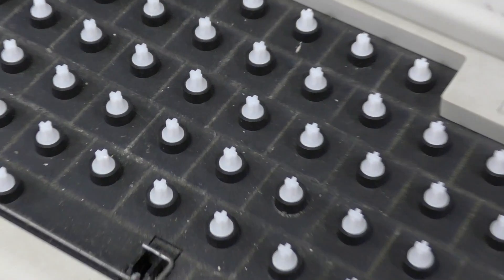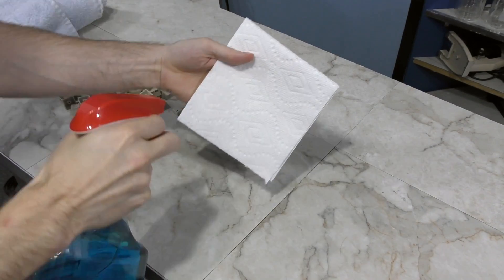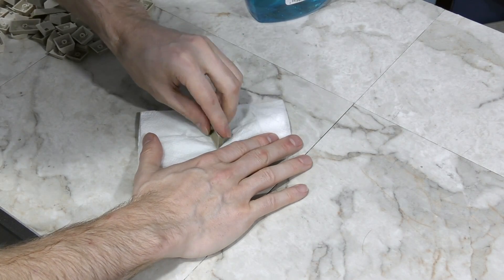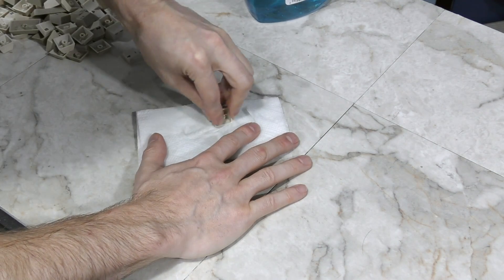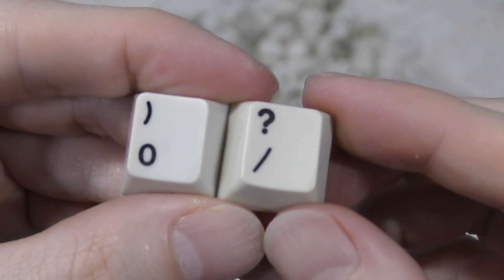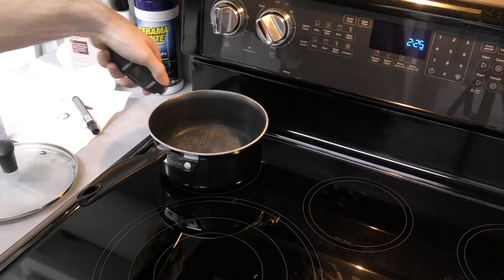All of the keys were removed, and there is a very thin outline of dirt showing where all the boundaries of the keys were. I've decided to just clean the keys with Windex and a paper towel. There are many ways to do this, including using running water in the sink, but I've found that this method is just about as fast and I don't have to wait as long for the keys to dry. I noticed that a few of the keys are slightly darker than the rest, almost like they've yellowed some — it wasn't as obvious when the keys were dirty. It seems to be only the white keys, so I'm separating out the gray keys. I'm going to try the heat method again — this will be my first time using it on an actual restoration project.